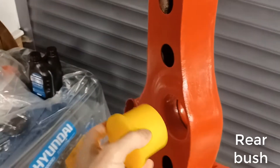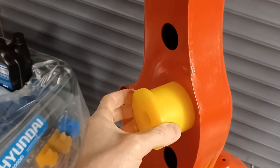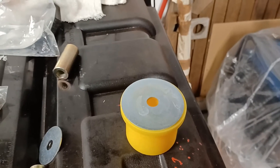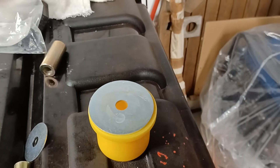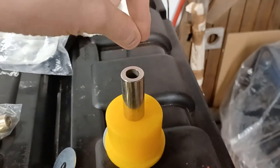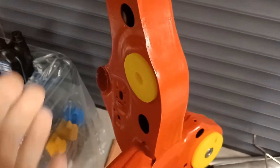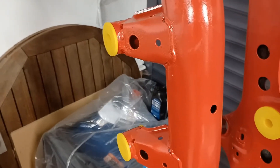The other thing I found was a diagram showing the installation for the big front bush - the flange part of the bush goes on the inside. I then saw a picture on Team Hamster's site where he'd installed this bush, and he has put the washer on the inside so the bolt bears down onto the insert. Inserting the bush was really easy - I just used the palm of my hand, slapped it a few times, and pushed it right through.